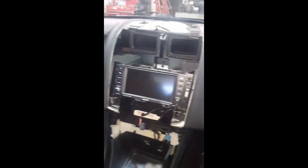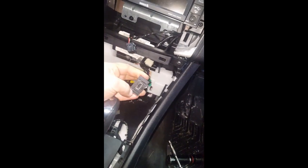Dodge Avenger heater core removal. To remove this center console club box, all this stuff is clipped in. There are bolts down there and two bolts in here to get the center piece off before you can get at those two bolts. This pulls out with clips, and this does not unplug — you have to undo the clip to get it to release.